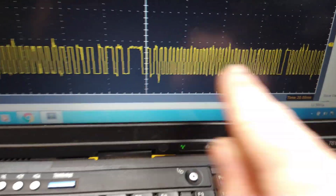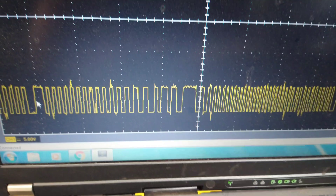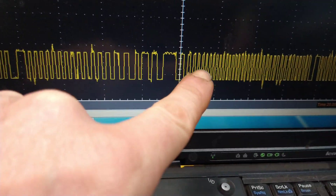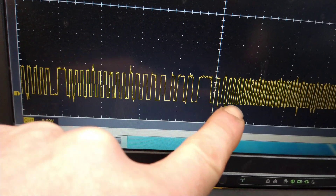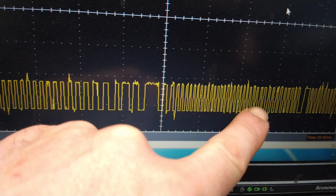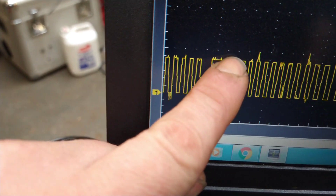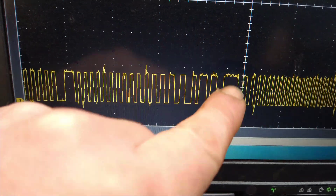The bottom and top pieces are similar, so I think this one in the middle is actually the faulty one. Somewhere there's going to be a bit missing on the ring. The spaces look different — closer together there — but that's just because the engine's slowing down on compression. That's all that is. The main thing is it should look like down and up with equal spaces. This is the bit that shouldn't be there — it's just missing a tooth.